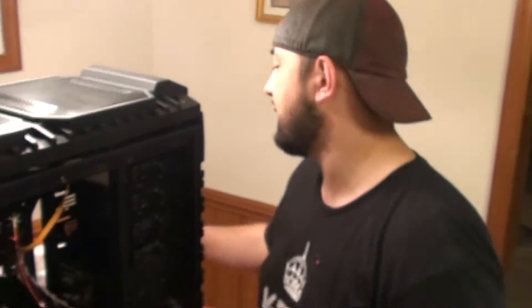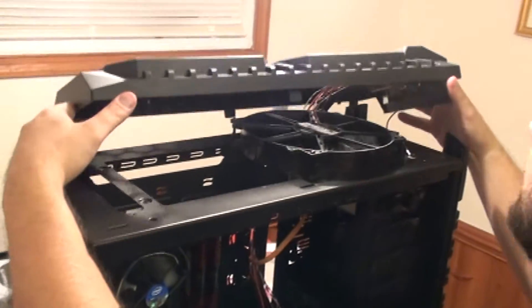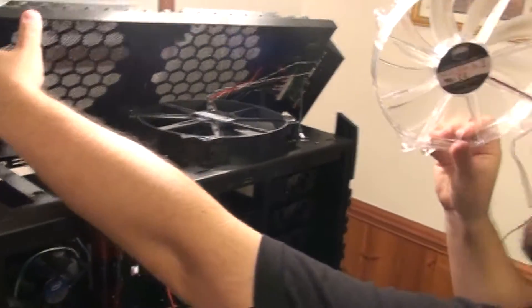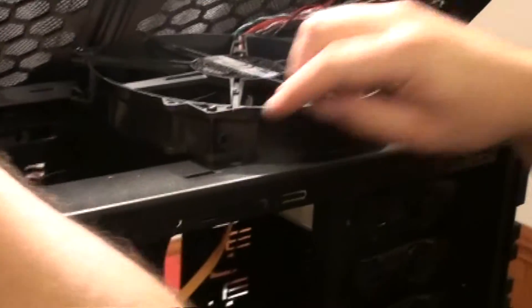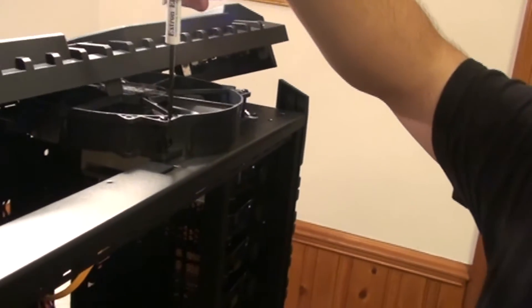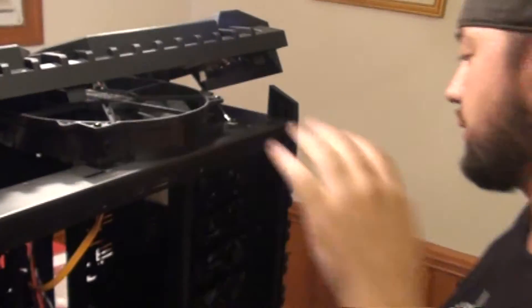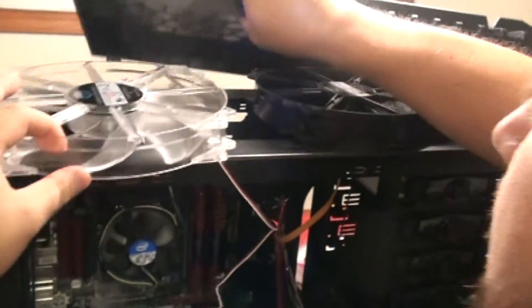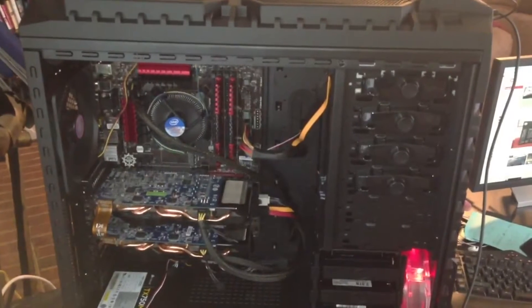All right guys, the next step is to install the second fan inside the case since it only came with one. We removed the top panel and found that the Cooler Master fan they gave us came with tiny screws — you can see how small they are. They don't work because you need a small screwdriver to reach inside, but you can't get enough torque to thread them in. So we went ahead and pulled the fan from the back, replacing it to the front since we have the right screws, and now we're putting the other fan we have on the back side. Let us screw this down.